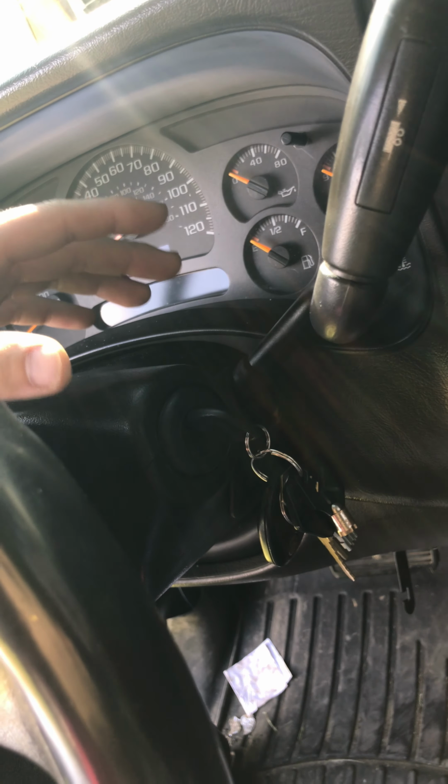And you can't see it in the video, but there's a little plug right there that you're going to pull out, that gives you access to drill the hole for your master cylinder and such. But on the 2001s and up, there's actually a pilot hole that's already there in the firewall to make this easier. Now on the 99 and 2000, there's just a dimple there. You can't really see it on this one, but yeah, 99 2000 just has a dimple there.